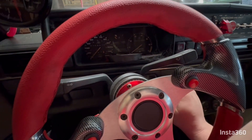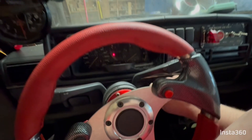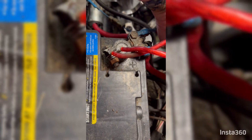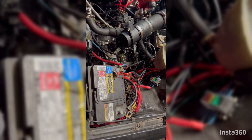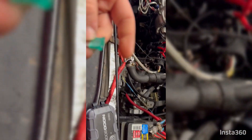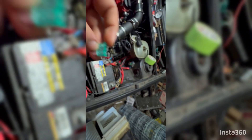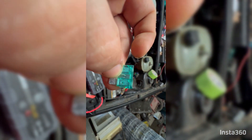All right, we'll try her again. So this is part of our jumper harness setup, and we got that from Sal from S&P. As you saw, we were trying to whirl it over. We have these fuses in here — this one's good, but this one I pulled out. If you can see that there, she's blown. So we'll have to replace that fuse. I ain't getting no fuel, I believe. Makes sense. We'll get a 30 amp fuse — 30 amp, sure is — and we'll go from there.